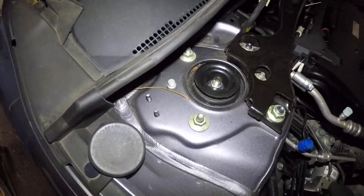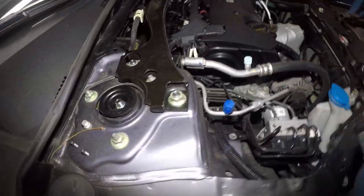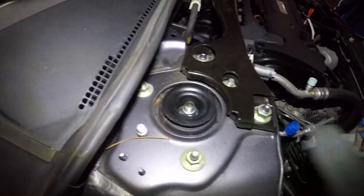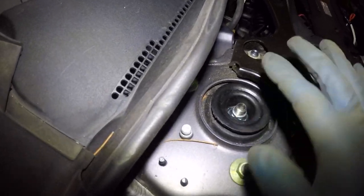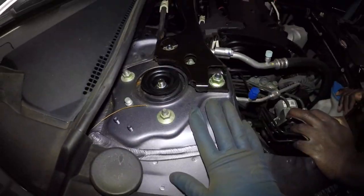I'm going to have my friend help over here. All right, he's going to put his hands here and push the car up and down. If you put your hand here, go ahead, push up and down. Make it bounce. And if you feel a clunk clunk here, pretty much your strut mount is bad. But what I've done on a few cars was...